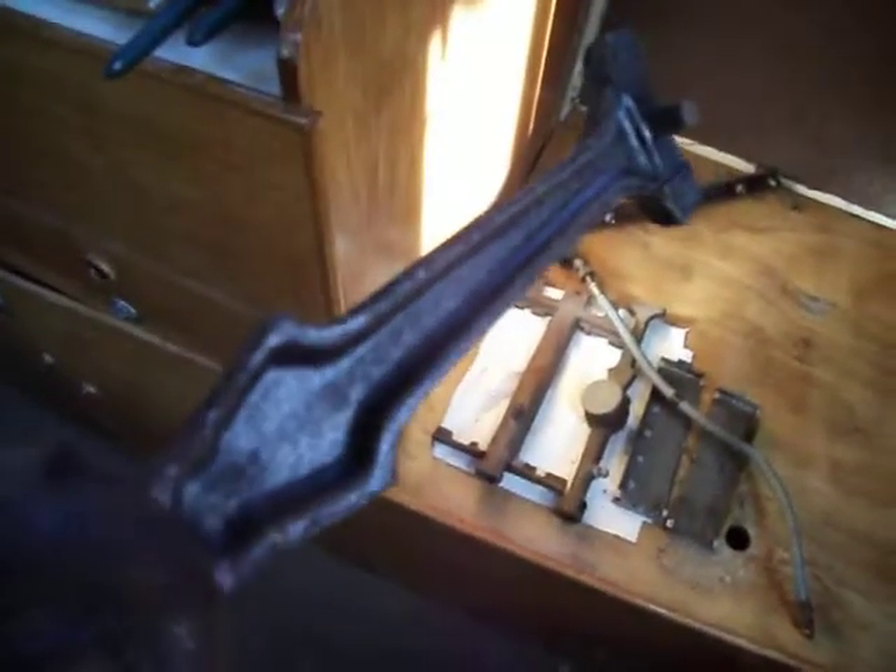If it doesn't leak we'll just take a wire brush and sandpaper to it and paint it all — I've got some nice high temperature enamel, 1200 degrees. You can see that these burners originally had some black paint on them. I thought it was baked enamel but I think it was just black paint, and it's burned and rusted off over time. So we'll wire brush those, get them nice, and put some high temperature enamel on them again — they'll look like new.